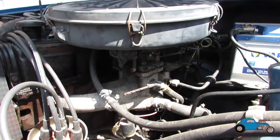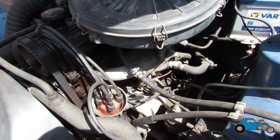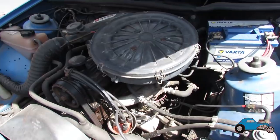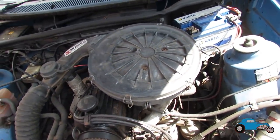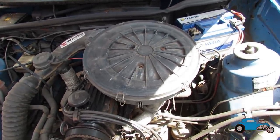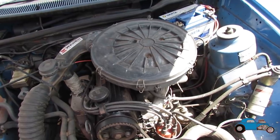This is the carb that I'm going to be replacing. I'm not too sure what this one is, but I know it isn't a Weber 3236, which is what I'll be putting on here. We've got a lovely little granddad mod just there. Also this inlet manifold won't be the one I'll be using — I've got another one to go on. The reason I'm actually replacing the carb is because once it's been started up and run for a little while it just doesn't run very well at all. It's very sluggish and when you turn the car off it actually runs on sometimes as well. So I'm looking forward to getting the other one on and seeing if it makes a difference.